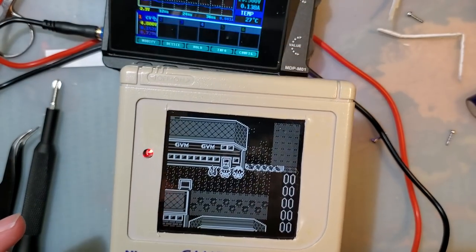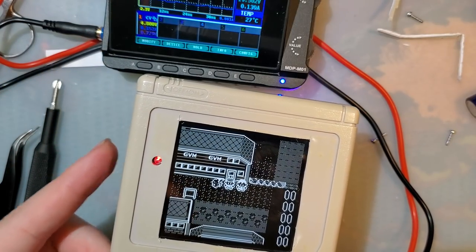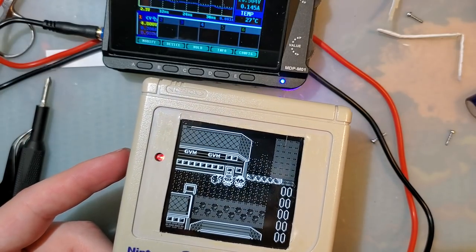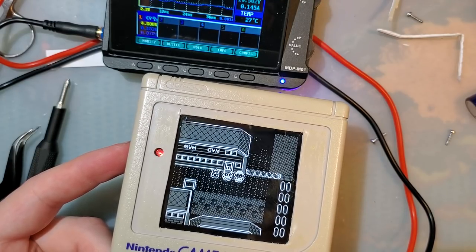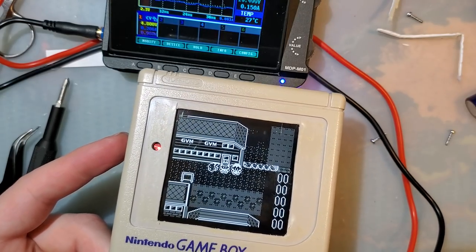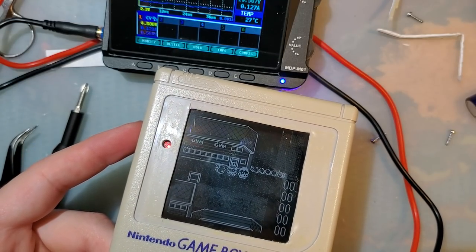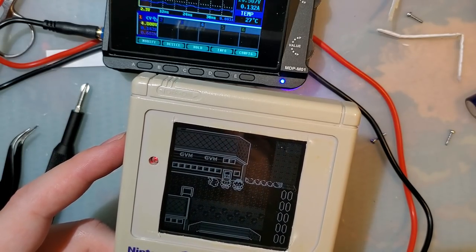Alright. So, there we go. That's at whatever default brightness level this is. If you scroll it without pressing any buttons, you can set the brightness to whatever you want. At max brightness, it looks like this thing is pulling about 182 milliamps, and we'll set it down to the minimum, and that goes down to 121 milliamps. So not too bad, not bad at all.